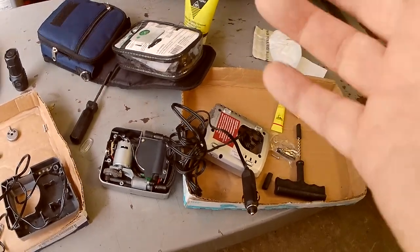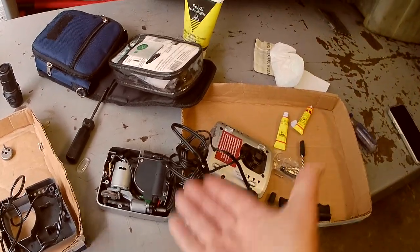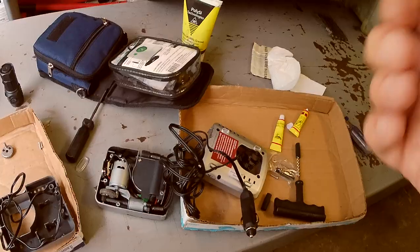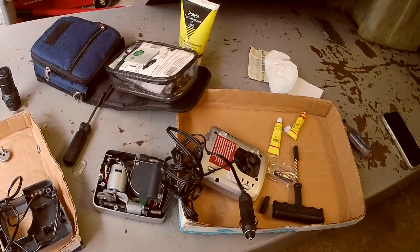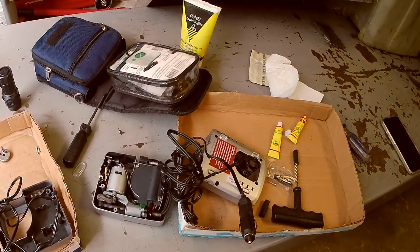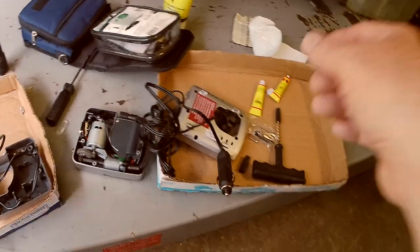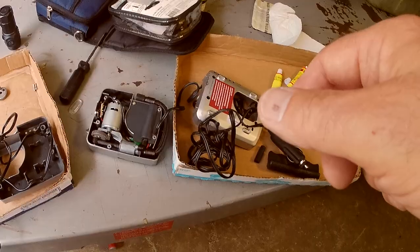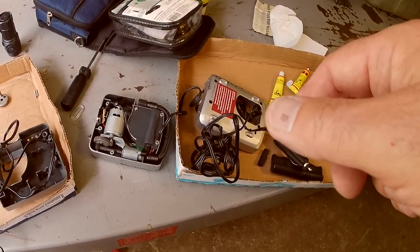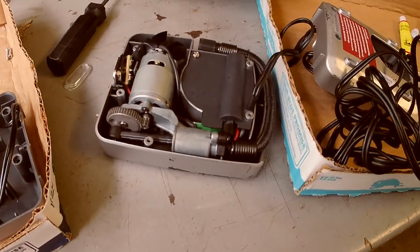If you're pumping up a car tire, it's going to take longer. It's not like on television where they show a tire going up really fast with those battery powered ones. Don't waste your money, because the battery is going to go dead unless you take that thing out of the trunk every month and keep it charged up. At least every 2 months. You want to get one that you plug in. These were $10 brand new. Those ones on TV are $90. I don't know if it's free shipping or not. But that's all they are also, the same thing, electric motor with a little single piston.